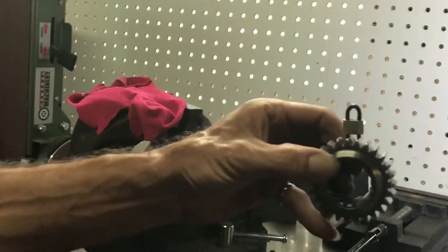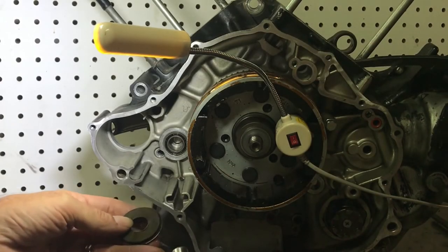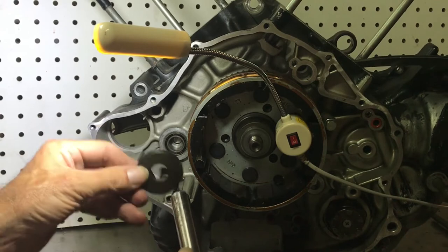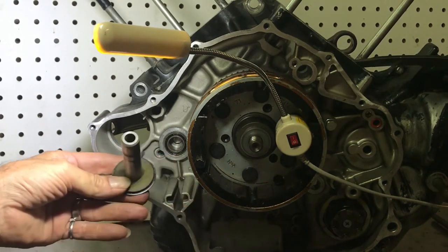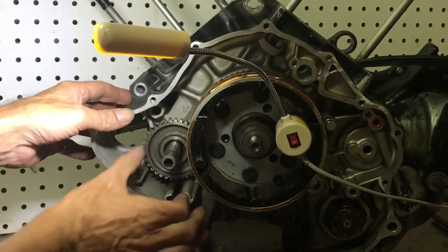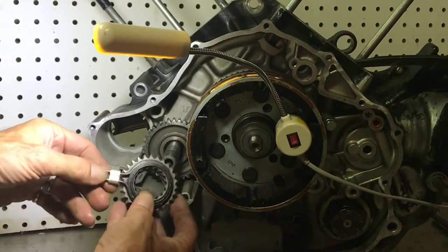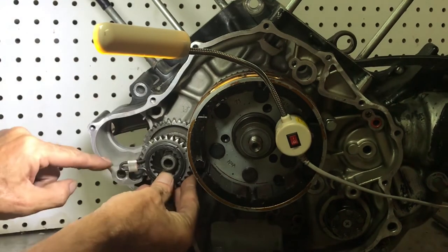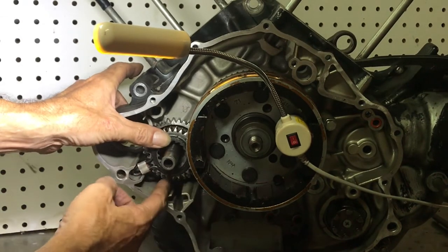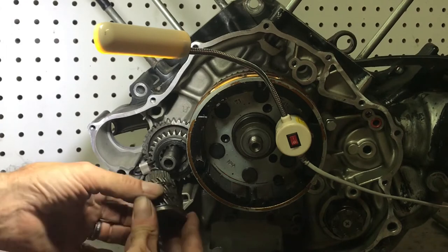Now go back to the motor for reassembly. If you've never done it, it seems complicated, but if you do it in a certain sequence it's not too bad. Start with the little bumper washer that goes in the back on the shaft, then put the gear on the shaft and bring it up behind the flywheel. Next, the Bendix gear goes on — it'll be loose — then slide the clip on with the clip tang in position.